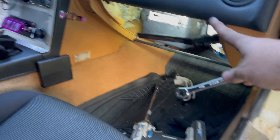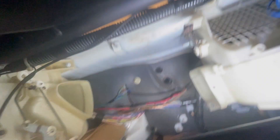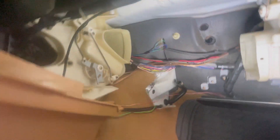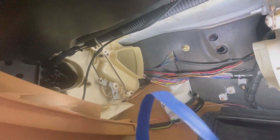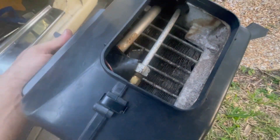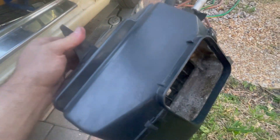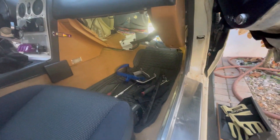You're going to have to take it out with this. After taking out the following brackets as well as the two nuts holding it from up top, and since I didn't have the mount for the heater core box, I had made one out of tape last time I restored it. After that, I'll just quickly pull it out — and I have it right here. This one I had cleaned up and restored. It still looks a bit dirty, but I have all brand new internals going in. That's pretty much done with the removal.